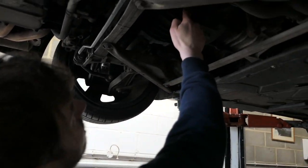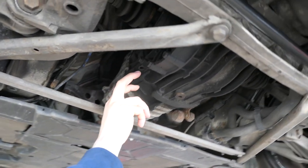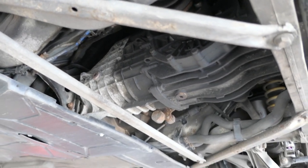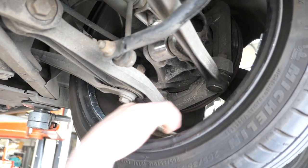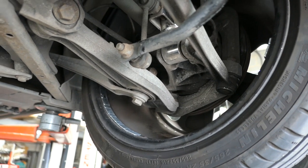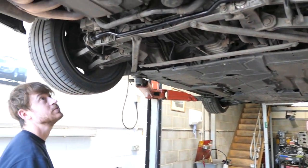Just the flanges from the gearbox — they're just leaking. This one's a little bit worse than that side. It's fairly common at this sort of mileage and it's a fairly straightforward fix, not too much of an issue. And the back plates have corroded themselves loose, which probably means replacing. You can put a big washer under there, but they're not that expensive, so it's easier just to put a new one on it. Other than that, it's in fairly good condition considering the mileage and how much you drive it.